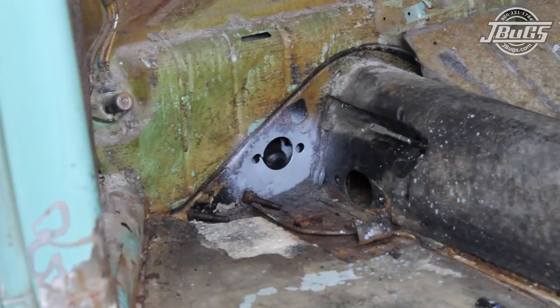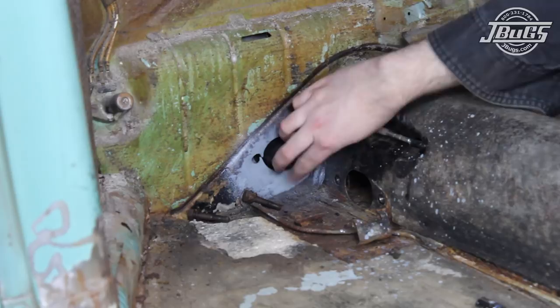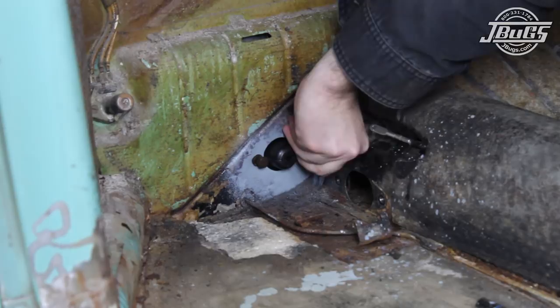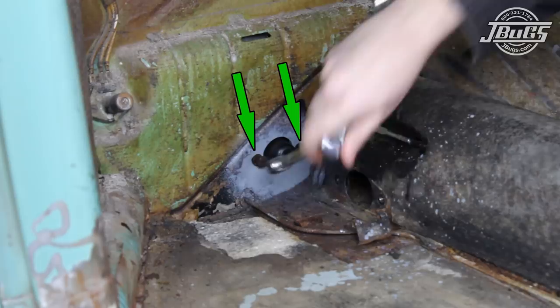At the front of the car, the new master cylinder is set in place on the chassis at the front firewall. If your pedal assembly is still in place, an assistant inside the car can make sure that the push rod is lined up correctly. Then the master cylinder can be bolted in place to the firewall. There should be spacers inside the front firewall for the bolts — the spacers prevent the bolts from crushing the sheet metal as they are tightened. Ours are missing, so caution is used not to over tighten the bolts and collapse the metal any further.